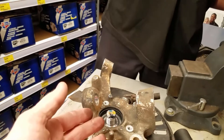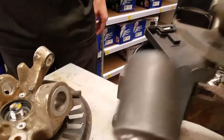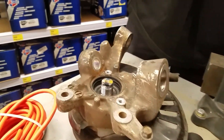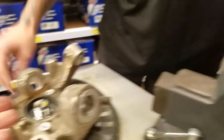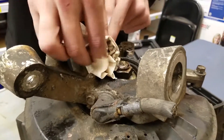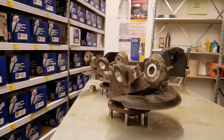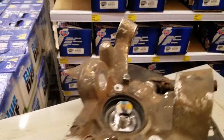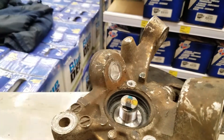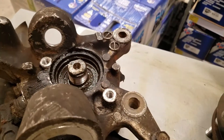So we were able to get this one off pretty easily. You're just going to need a one and one quarter socket, or 32 millimeter. So this one came off super easy — I mean this is brand new, someone already replaced this. This one on the other hand is probably like 23, 24 years old, so Julian just sprayed it real quick and we're just going to zap it off. So got them off, finally. This one looks like it's already been replaced recently so it was pretty easy to zap it right off with that 32 millimeter socket with the impact. This one you can obviously tell it's been old, so this one took a while, took some loving, but we finally got it off.